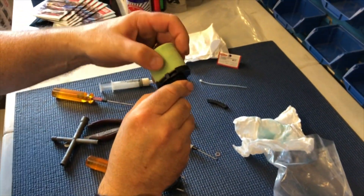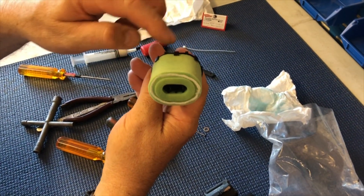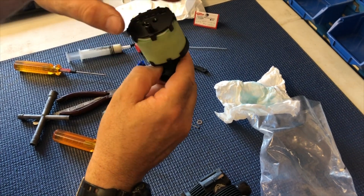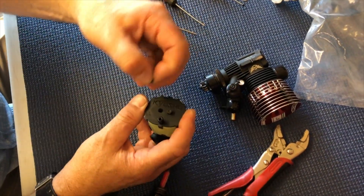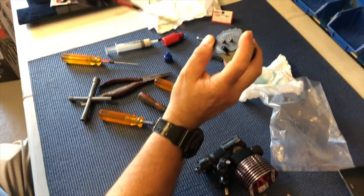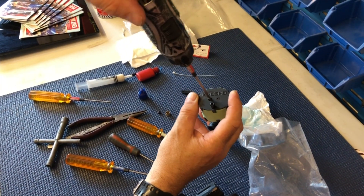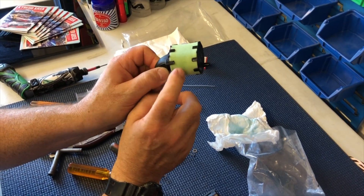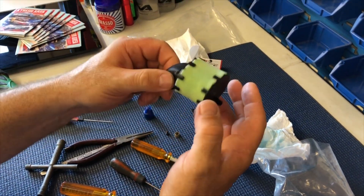Slide the filter onto the air intake and make sure it's all seated nicely. Make sure you've got the two top lips at the top — this keeps a little air space away from your body, and that's how you know you've got it the right way up, same orientation as the Kyosho writing. Clip it into position and put your two screws in. Set your torque setting if you've got a Hitachi driver to one — this is the perfect setting. When they're new it can be a bit tight but once they're bedded in it doesn't over-tighten. Make sure the air filter is nicely seated — you can see it's nice and tacky against there, a good seal so you draw air through the filter and not through the sides.